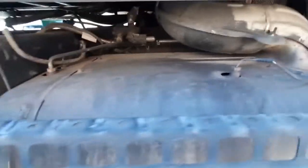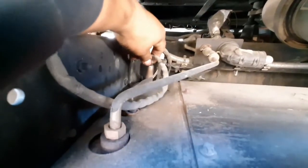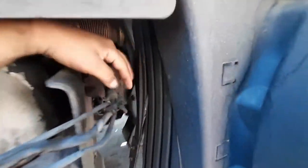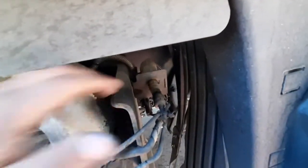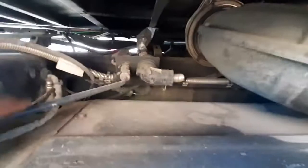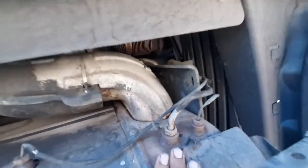As you can see, nothing on the one box itself, but I did find two things. This is your inlet NOx sensor, and there's loose pressure coming out of there. Also, see that — that's cracked. So I'm going to replace that.